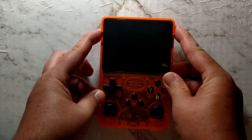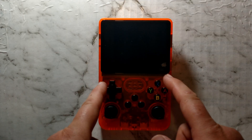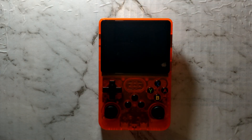We'll just power it on. We do get the ArcOS splash screen, so that's a great sign it is working. It does take around five minutes to finish the initial boot setup, so just be patient. If instead you're getting a red blinking light when you power it on, you've most likely done something wrong with the uBoot or the DTB steps. Just make sure they are named correctly and you did copy the correct files.